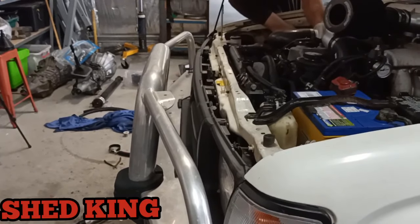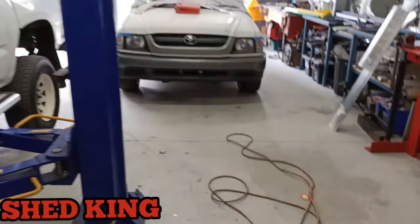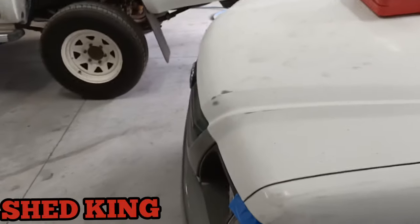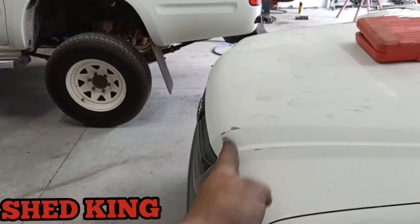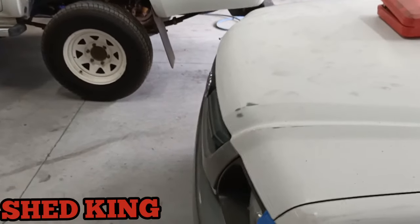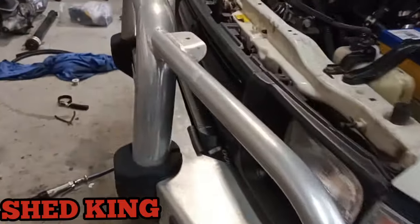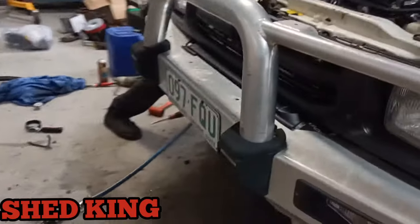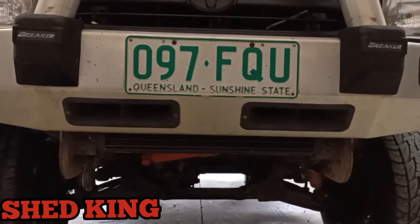From the 11th month of 2001, they started bringing the grill further out forward, just like on the shorty. So you can see here the alignment on the bonnet is totally different, where the 2001 before is straight, so it actually fits an intercooler way better. It can be kind of painful to get that fitment where you want it, but he's got some nice ducts there that'll shoot it straight up inside of it.